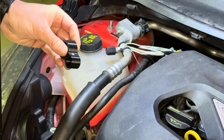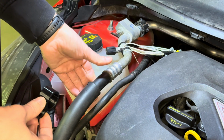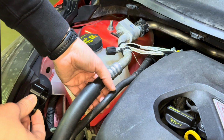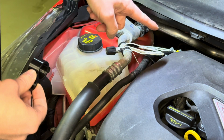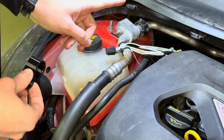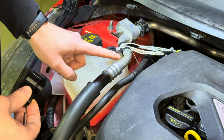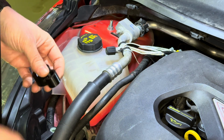Consideration number two, heat resistance. This is a part that goes into the engine bay. The AC hose is not a problem, but the water return gets really significantly hot. It gets actually superheated by the flow of the water that is cooling the turbo. So it is also one of the issues that affects all of these cars. If you're running bigger turbos, you're putting very hot water back into the coolant tank. So temperature resistance is number two.